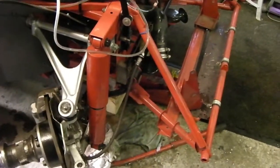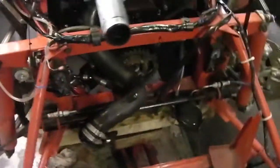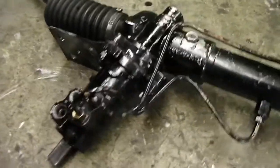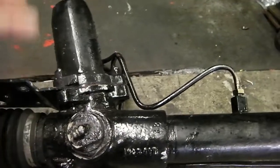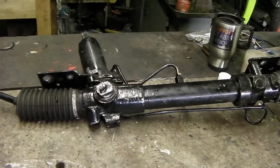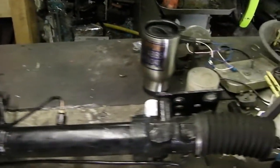The easiest way to get these steering racks off is to take the radiator out, disconnect it all, and it easily slides out from one side then out through the middle. You can always tell a right-hand from a left-hand side steering rack by simply flipping it — the big nut, which puts pressure on the rack itself, and the tower, are in that configuration on the right-hand side. On a left-hand side rack, they would be at the other end.